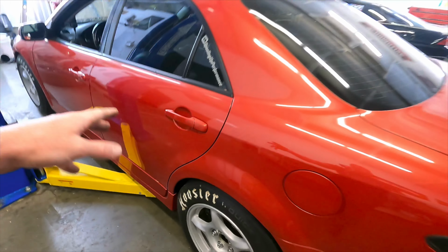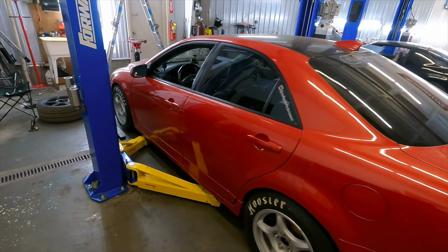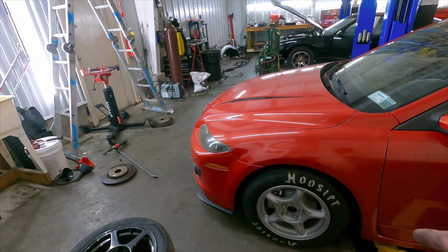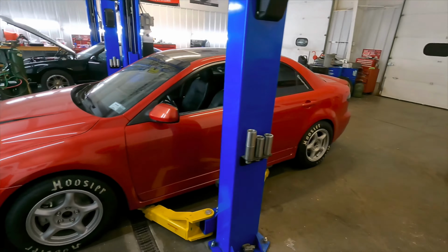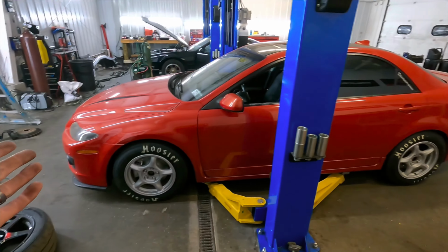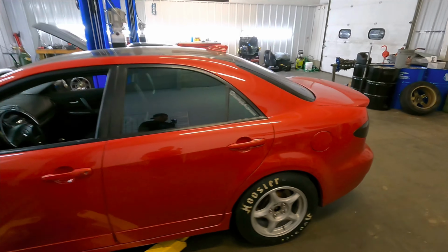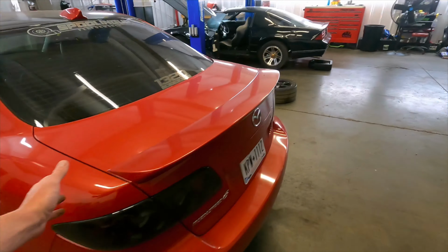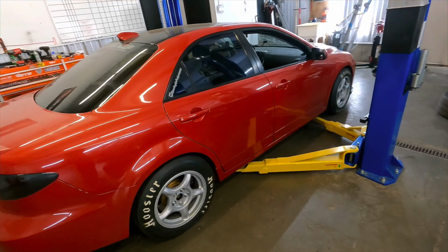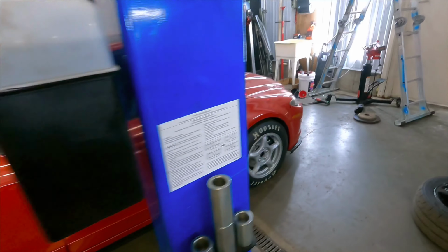And Justin and the guys at Damon both said we're gonna roll with 15 PSI of tire pressure in the front, 18 in the rear, and we're gonna try to launch this thing at 6,000 to 6,500 RPM. You wanna keep the RPMs high, especially when you're first testing out a car, just cause you will produce wheel spin, which is good, but damn.